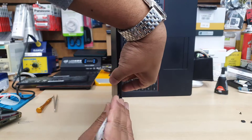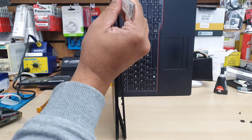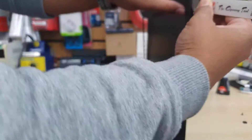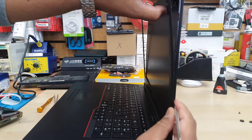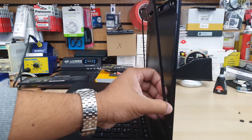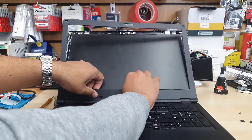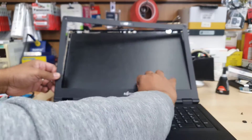Opening the E-series front bezel is a little different from ordinary laptops. I'm using a flat opening tool called a Spudger. Put it in the gap and gently pry it, pushing toward the back so the front bezel comes out. It will make a little cracky, clicky noise which is absolutely fine. Before pulling too much, be gentle and check all the clips and connectors inside, doing it step by step.